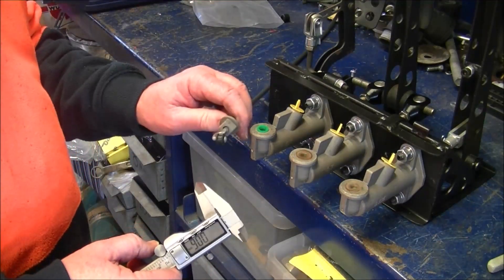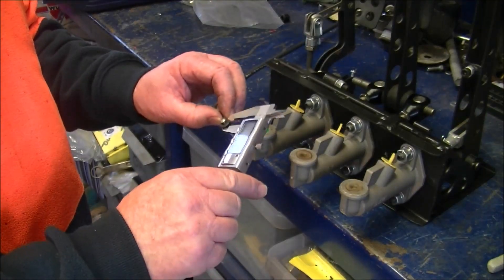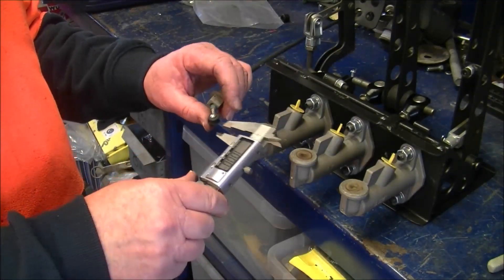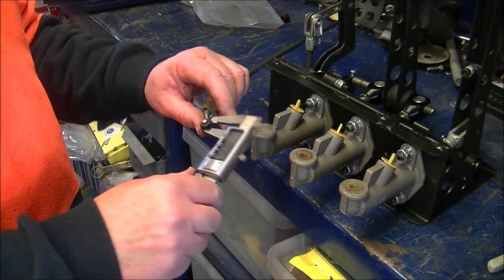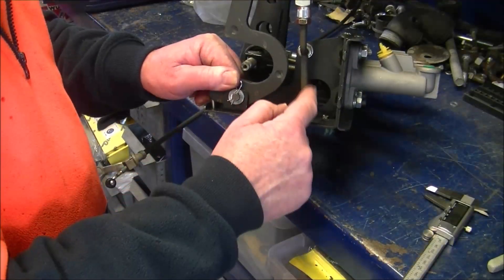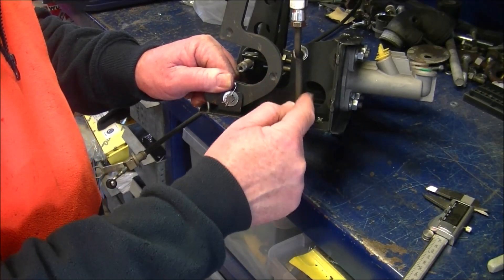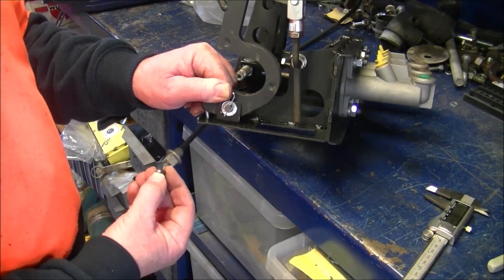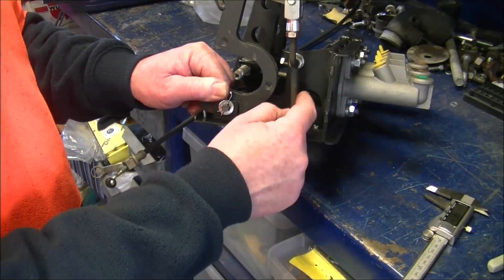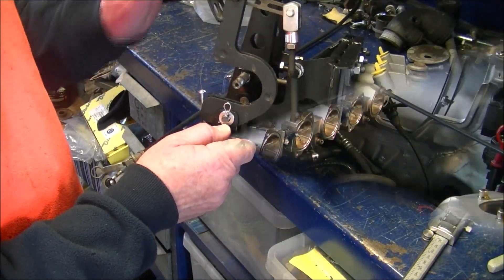So what I've got to do is measure the grommet there. I'll still use this grommet and lever on here, and I'll make an adapter on the pedal off this rod here. It'll drop back in here and have a 10mm hole through it — I might put a couple of 10mm holes through it — that'll take that grommet, and that'll locate off the back of this arm, which activates like that.